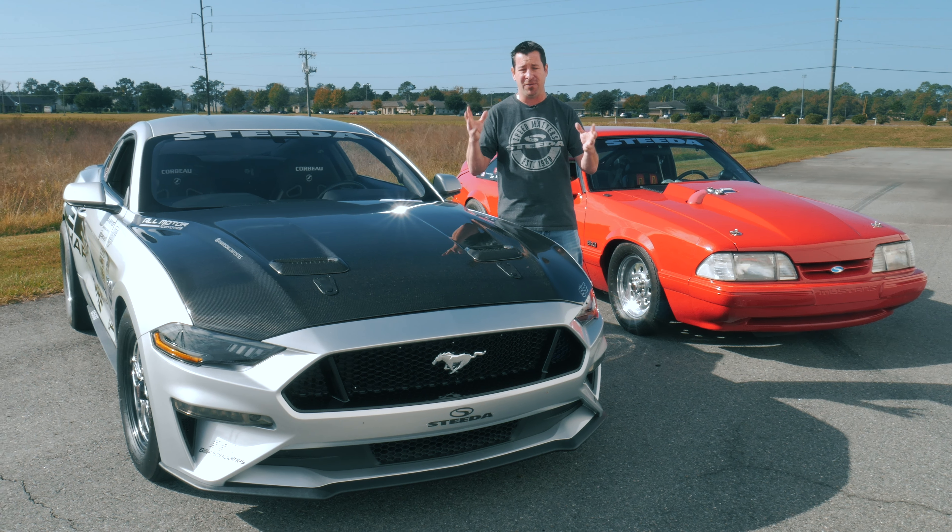The next thing is getting heat in those tires. I don't care if it's slick, drag radial, or a bone stock Pirelli — I've never experienced a tire that does worse without a little heat in them. So roll into that burnout box and do a good smoky burnout — two, three seconds, pull it out. You want to break down that rubber so it's providing optimum traction when you go to launch your hot rod.